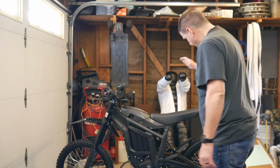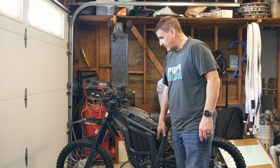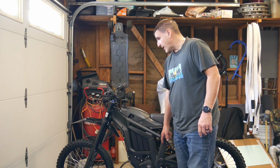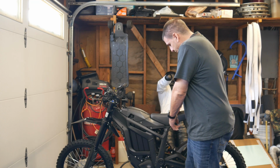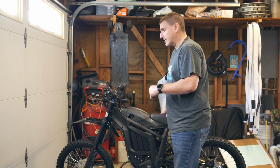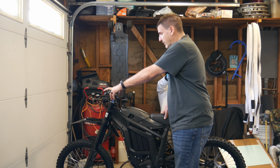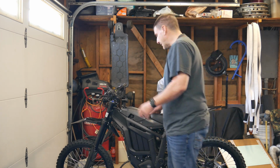So okay. Also, yeah, don't forget to unclip the vent tube for the drive down there. Completely forgot about that. It was funny, I was down there checking some bolts and I'm like, oh crap! I forgot to unclip that. You leave it on there and you just unclip it. It lets it breathe. When you load this in your vehicle or in your truck or whatever, and you're going to put it on the side, make sure you clip it back closed, or you're going to get fluid leaking out of there.